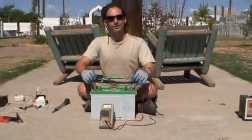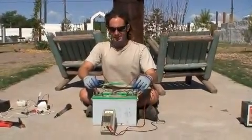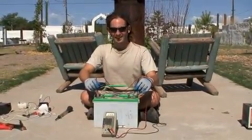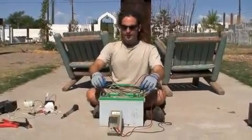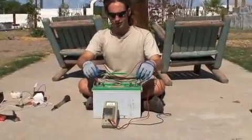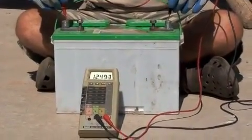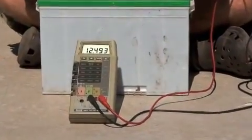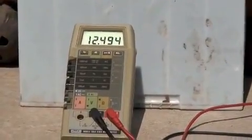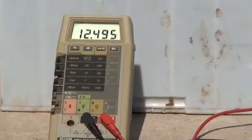That's a pretty good voltage for a battery that's just sitting. If it drops below 12.3 volts, that's bad — you're sulfating again. Crystals are being formed on the lead plates and your battery is slowly dying. This is what I like to do when testing batteries at marinas or auto parts stores: do a quick voltage check to see where the batteries are, then take the batteries with the highest voltage. You can also do a load test, but this is a much faster way to quickly go through batteries.